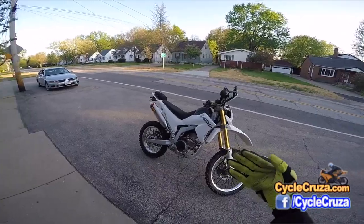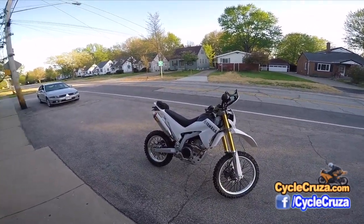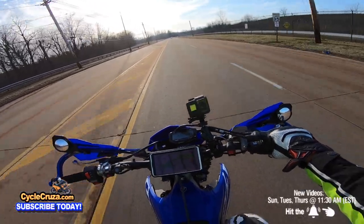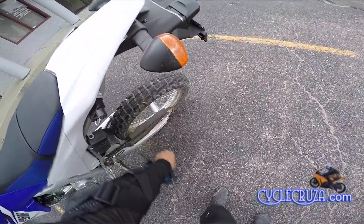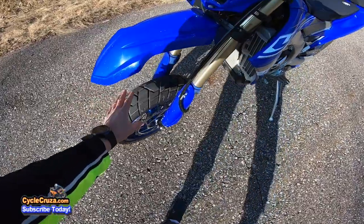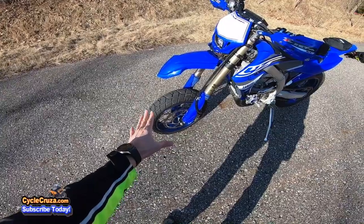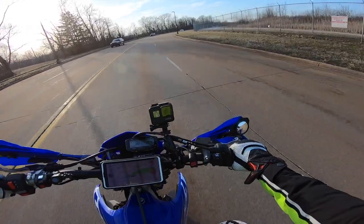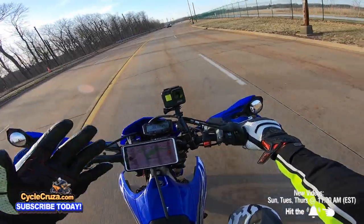The 21 to 18-inch wheels on a dual sport — you can't really make those wheels tubeless for street use. You have to have inner tubes. So if you get a puncture out on the streets, you can't just fix it like you can on my bike, which is tubeless with 17-inch rims. I can just patch it up in less than five minutes. With inner tubes you've got to take the tire off — you're not going to be doing that on the side of the road, so you're probably going to have to call for a tow.